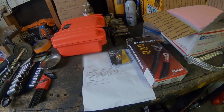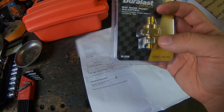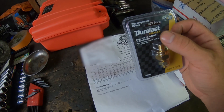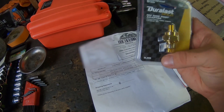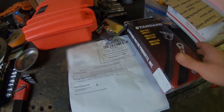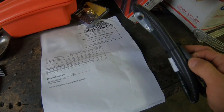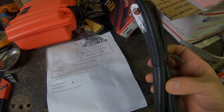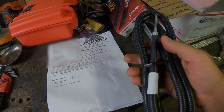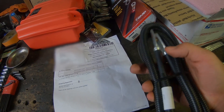Here are the components for the electrical upgrade. This is a stud extender so we can add more accessories to it — you'll be needing this especially when we upgrade to the electrical fans later. Here's the part number; I got that from AutoZone. And here is the big cable — we're upgrading the thickness of the cable that goes off the back of the alternator to the battery to help with charging. This cable alone can help if you're having slight issues, but I would recommend going up with a bigger alternator too.